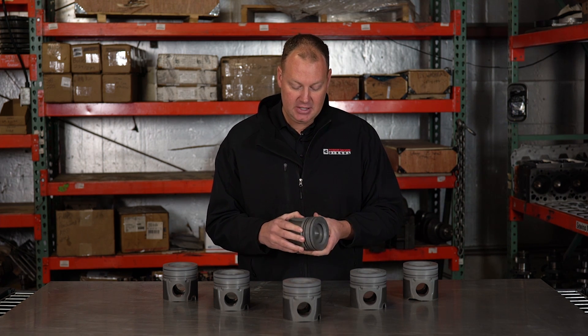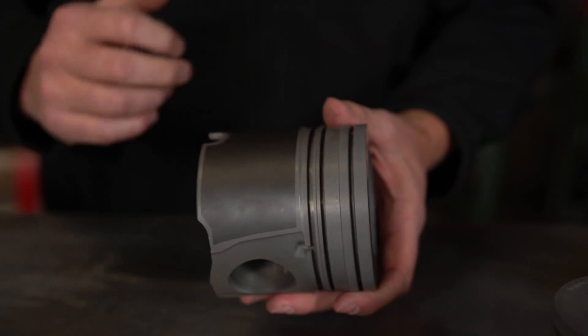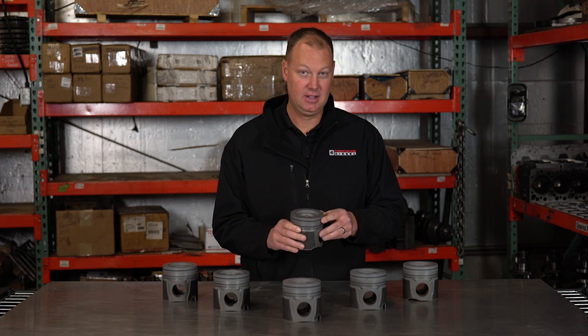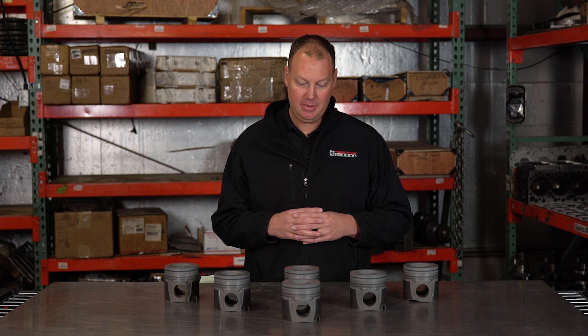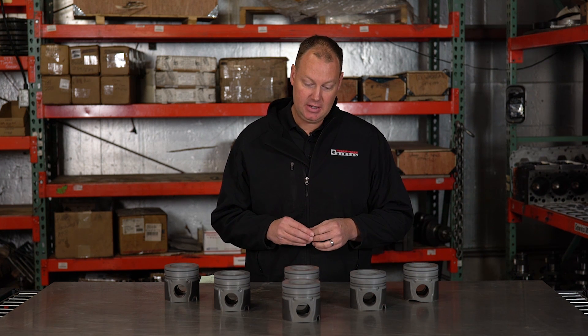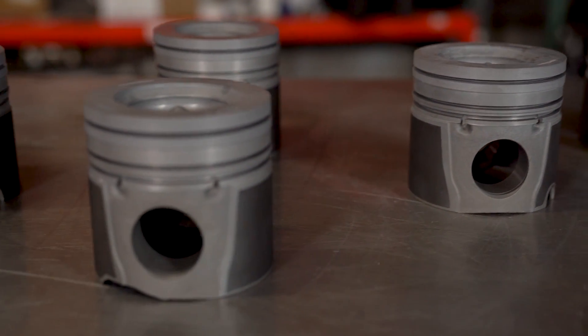So what's cool about this? You can see here there's a little lip. This top is different than the bottom. The bottom is forged aluminum, but this top piece is actually called a ceramic matrix — its ability to maintain its size at heat. A typical forged aluminum piston — the most common piston you'll see in real high horsepower applications — will expand about 20 to 25 thousandths of an inch at 500 degrees. Your cylinder walls will also expand, so you don't need that much clearance, but you still need a lot of clearance on a forged aluminum piston, which makes them feel real sloppy. You kind of want to let your engine heat up before you make power, so the piston expands to fit properly.